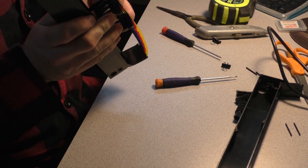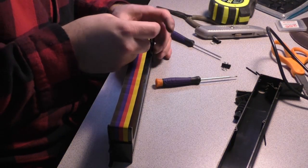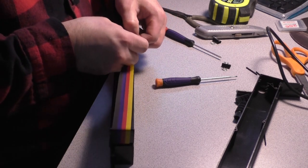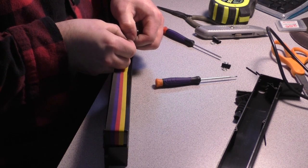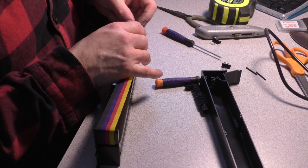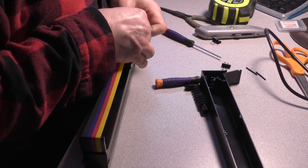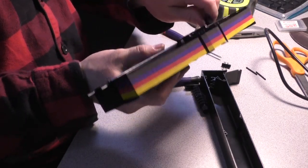And let's get this printer ribbon guide back in place. I'm going to use the shiny new steel bars from the replacement ribbon, and they'll fit because they're the same width. One of the most common printer ribbons you can still find is the Apple ImageWriter printer ribbons, which are very ubiquitous, very common. There we go. All right, let's test it out.